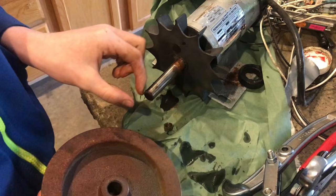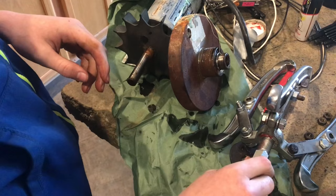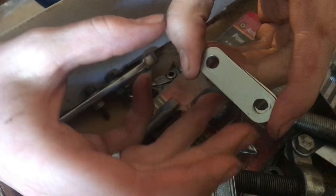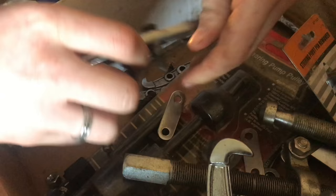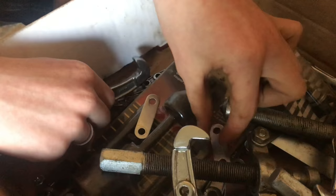I don't expect it to always come off that easy — sometimes they're just really stuck on there and it can be a big pain. But these pullers really work well. It's really important to keep grease on these threads. If you're in a situation where you're really cranking on it, if you double these up it'll give more strength so they won't fail, because with just one it can break through really easily. Sometimes the bolts here just shear off, so you need to get some hardened steel bolts so they'll be strong and won't shear off. It's important that all the hardware keeping everything together is strong.